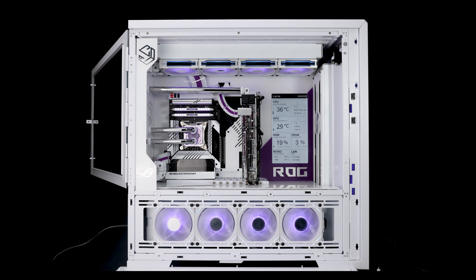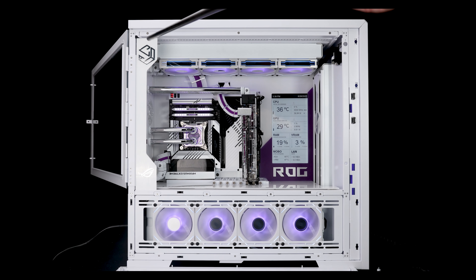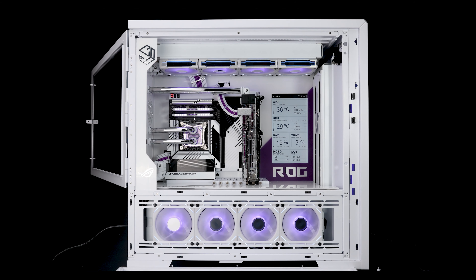My layout in this build: once I had this going, I realized I had this big empty space on the side. My pump is on the bottom, my distro is on the rear. This piece right here exists simply because the distro with the cover I made for it is in totality about 21 millimeters thick, and this case frame is about 18 millimeters. So this is simply here to make it look cleaner when the case door is open — when the door is closed, you don't see any of that.